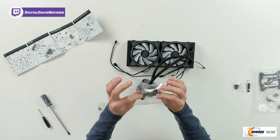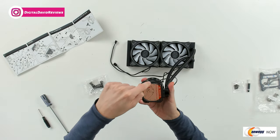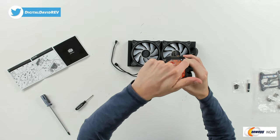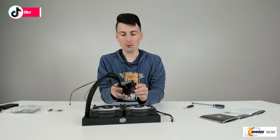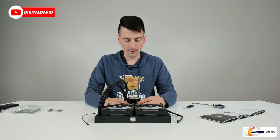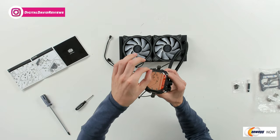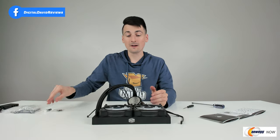Now it's time to install the two brackets for our AMD CPU and the four included screws. So we're going to take one bracket, install it right here and use two of those screws. And we're going to take the other bracket, install it right here and use the other two screws. You can see how we have everything installed — the screws go in through the bottom and then you can see the bracket on the top right there. Pay attention to the layout where we have both of them installed. Visualize how that's going to connect on the CPU with the two brackets that are already on our board. We have successfully prepped our CPU cooler. We just need to go ahead, remove this, attach it to the case, apply a pea-sized amount of thermal paste on the processor, and it's all set and ready to go.